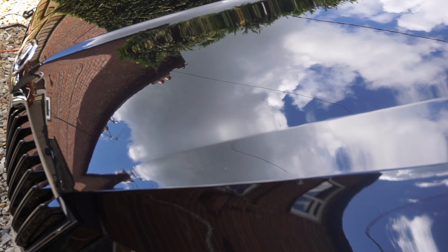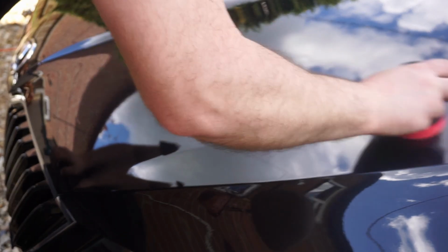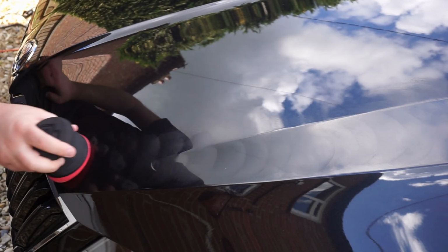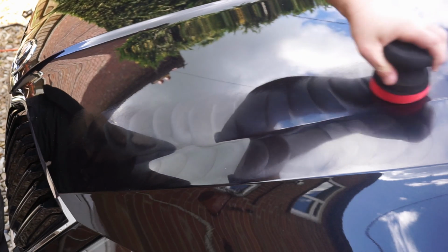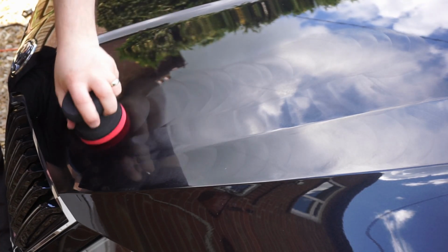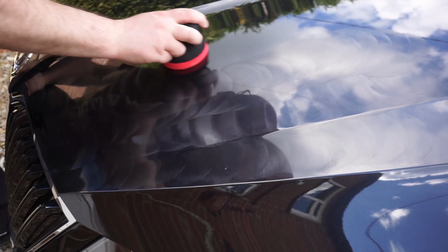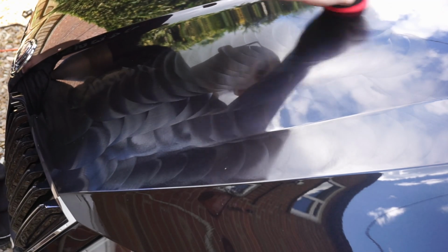It's finally time for a bit of wax protection. I think we will all agree that she's got a bit of a shine to her already. So here, this is the SGCB wax applicator. I really do struggle with pronouncing that name, so I'll have to write it down for that bit. A cracking little puck, comes with 2 little foam applicators, absolutely brilliant. Just slapping it on here, a little product goes a long way, small circular motions, and then we'll leave this to haze off and buff it off in a second.